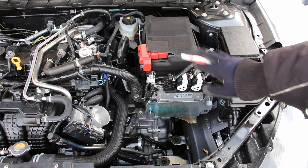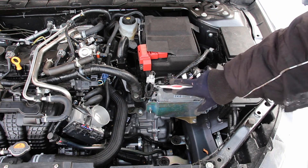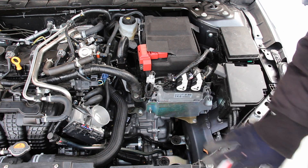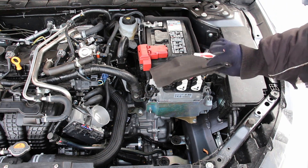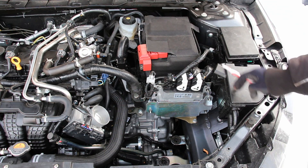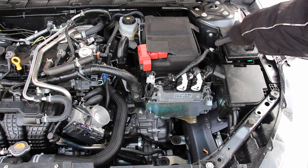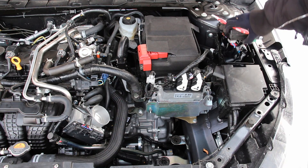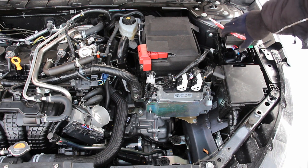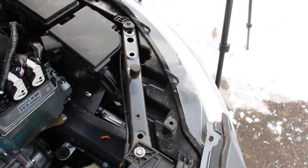For a modern car there isn't a ton of electronics under the hood of the Altima. We do have the ECU placed up here which is pretty close to the front — I don't typically like that because it can easily get damaged in a collision. Just behind it we have the battery with this little jacket to keep it warm in the winter. Over here we have the regular fuse box and over here we have an interesting one where the wires come up through the bottom and the relays are accessed from underneath — it's kind of hard to get to. What's worse is this other computer down here which can easily get hurt in any collision that passes the headlight.